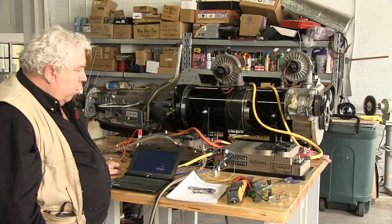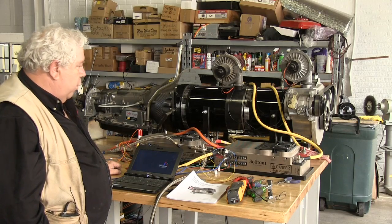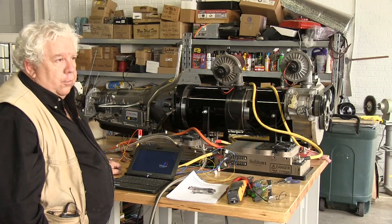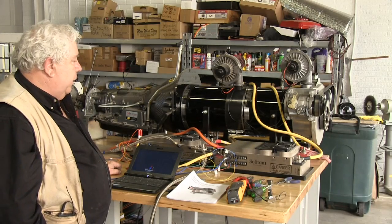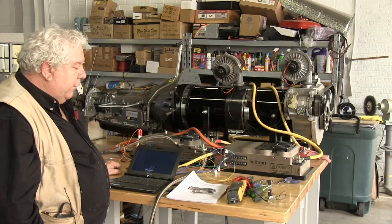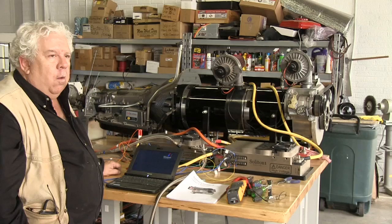3,000 amps for 1.2 megawatts of power. And that's kind of derated from what it'll really do. Those IGBTs will do up to 4,800 amps, and they can let you do that if you need to. And they're positioning that as a racing device. I think it's the King of the Hill mark at this point.